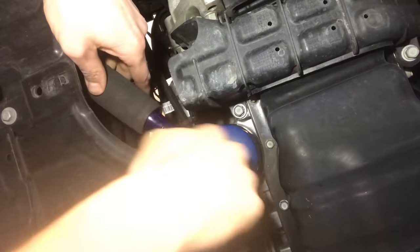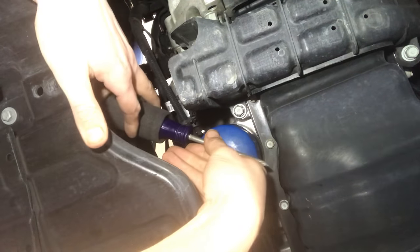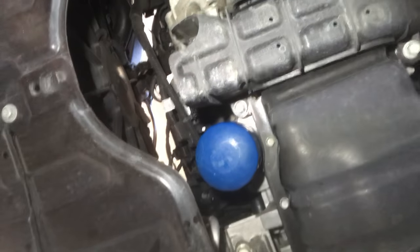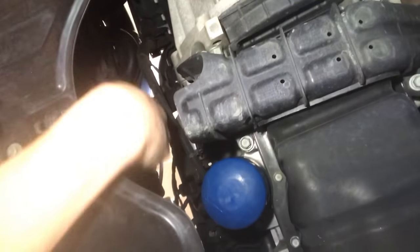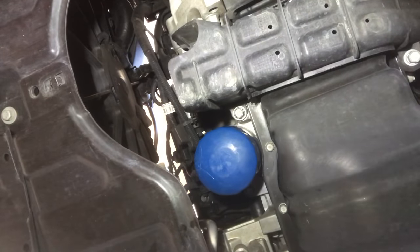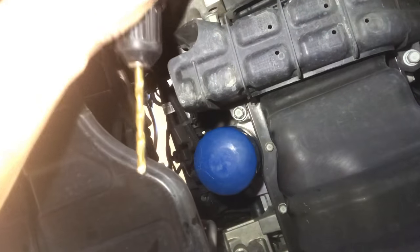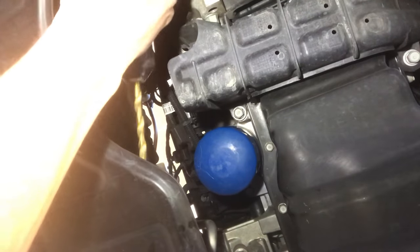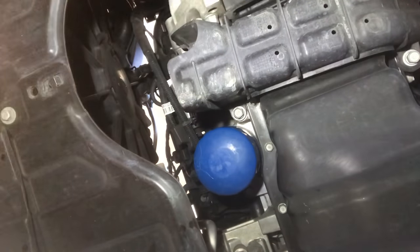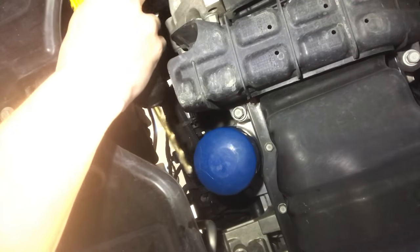You've got to be careful though — you can see the oil pan right here, you don't want the screwdriver to hit that. But this is such a tight area that I have no room to swing a hammer. So in this case, to create my hole and get my screwdriver through, I'm going to use a drill and get it up in here to start the hole through the oil filter.